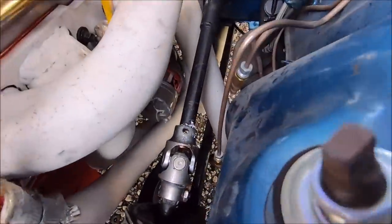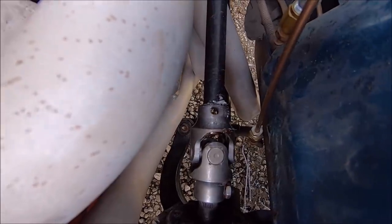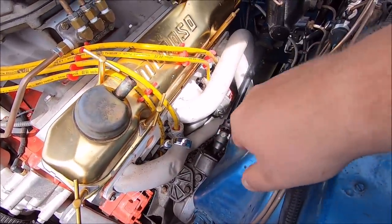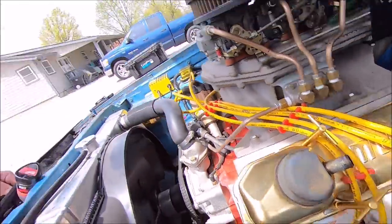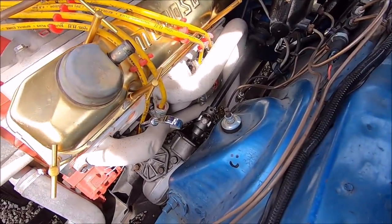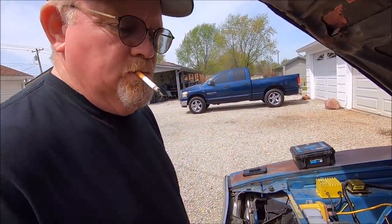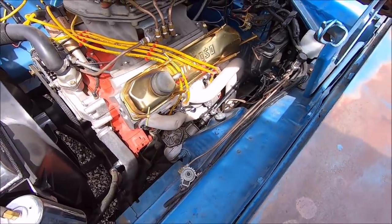Alrighty, so the hole is drilled. Look at that. It's beautiful. We got a hole. Now we're going to measure that, find the proper bolt for it, get it Loctited in, and then hopefully not have to worry about this ever again. What say you, Dan? I think so. We'll probably be using an Allen head bolt on this, which are harder than grade 8. So I'm going to measure that, we'll get a bolt, and get back to work.